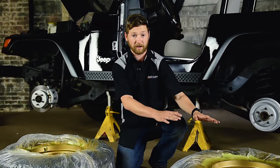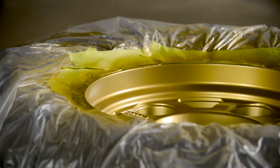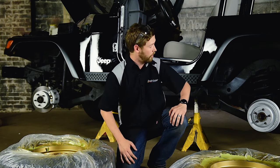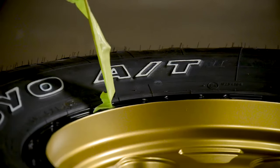So we've got the paint all laid down and it looks great. Although it may dry in 30 minutes, you have to wait a full hour before these are ready to be handled and put back on the car. When peeling off the tape, pull away from the painted surface.